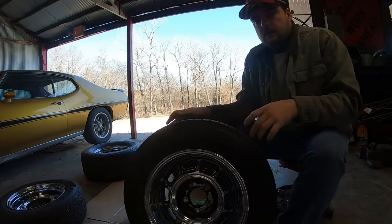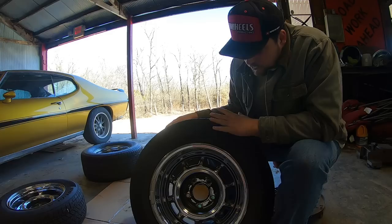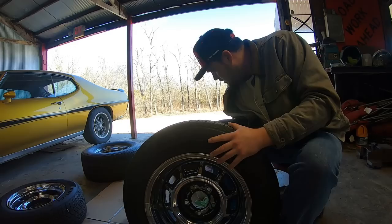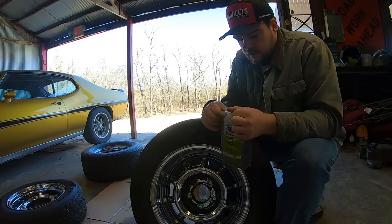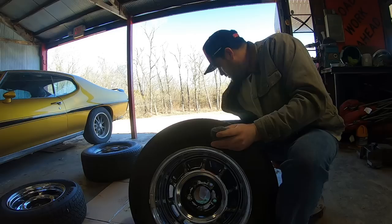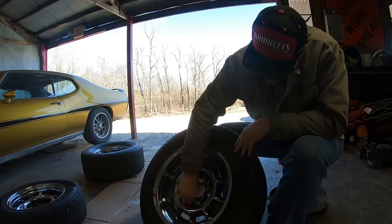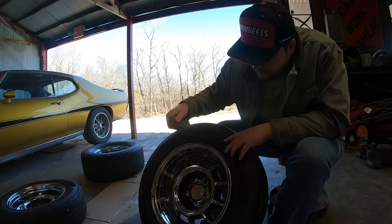Obviously a lot of this black paint is chipping and peeling away, and they've also been coated in some kind of slime. I'm just going to try to knock off the edges — they don't need to be perfect. I'm going to do that with some steel wool. This is medium grade, maybe a little too aggressive, but I wanted to try it. I also got four-aught steel wool which is a lot finer — that'll work well to polish the chrome and scuff up the area where we're going to paint.